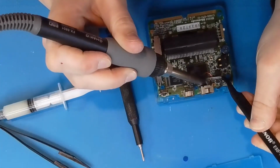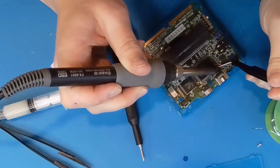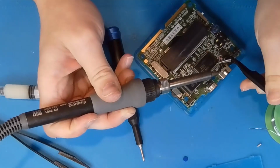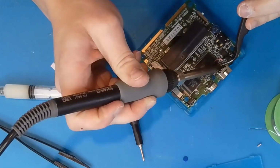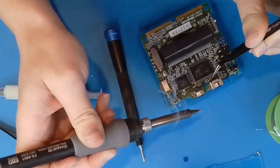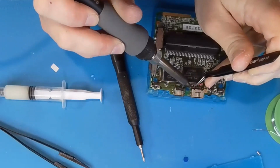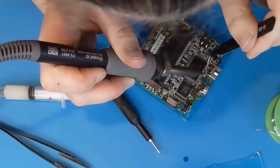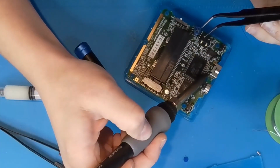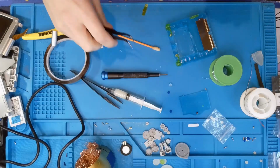There are two colored wires. One is copper and one is reddish in color, and the copper goes to ground. If you follow the directions, it doesn't quite work properly. And I learned this from Macho Nacho. I'll leave a link in the description below of his video so you could watch it as well. He found that it stated pins 3 and pin 6, and it wasn't. It worked with pins 2 and pin 6.